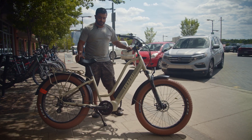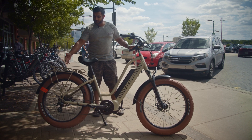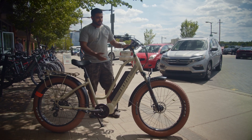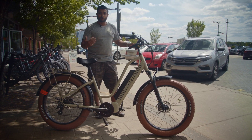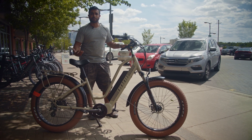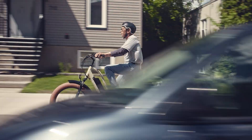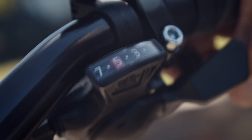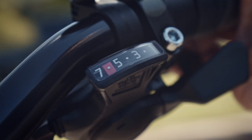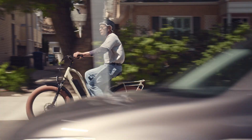Hopefully this explains the difference between the pedal assist levels and the different gears. In summary, the lower the level, the more work you have to do and the less work the motor does. If you're pedaling too much you're in too low a gear — if you want to gain speed, be on a higher gear so you have a constant pedal stroke while the motor does some of the work.